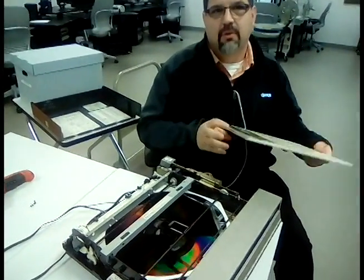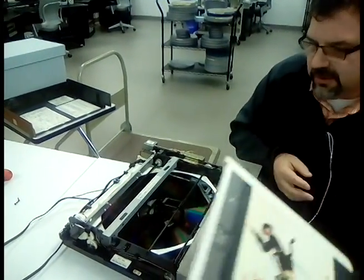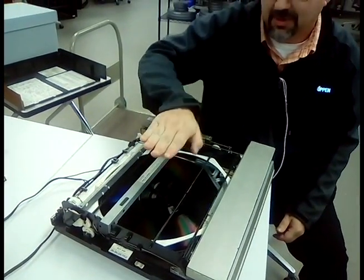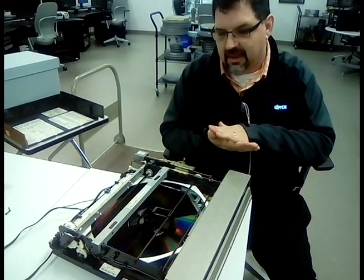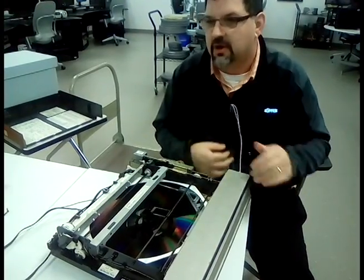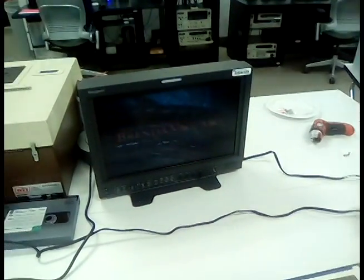You have to slide it back in, turn it over, and reload it. You can see the disc wobbling — there's a plastic platter underneath that has warped over time. And there's a good chance that the discs have warped a little too, which is giving you the little skipping in the actual film.